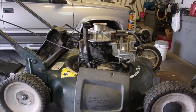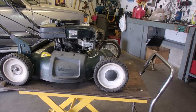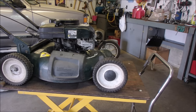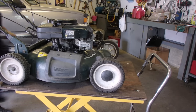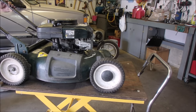It's funny, right? I'm shooting for 3200, and it always goes to 3180 or 3210. Maybe that's the detector. So I'm just going to reassemble this now, and all we got to do is an oil change. So after all that, it still needed to be primed to be started. So I'm going to try it again. Leaking on the carburetor. Isn't that something, hey?